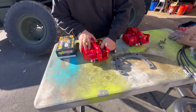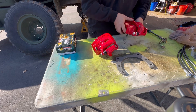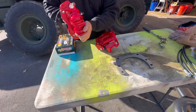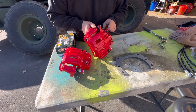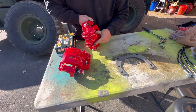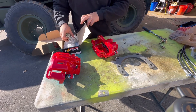Here's your calipers. One thing that's real cool about this is that these pads load up real easy. Once you get them out of the box, one thing you need to pay attention to is what determines left from right — this bleeder screw here. So when this is installed on the truck, that'd be the passenger side; this'd be your driver's side. This bleeder screw needs to be at the top — these won't bleed out if the bleeder screw's in the bottom. So if you flip it over to the other side of the truck, the bleeder screw's on the wrong side — you gotta pay attention to that.